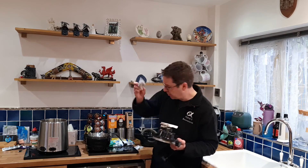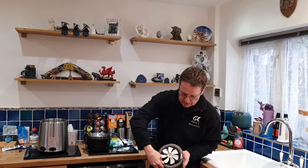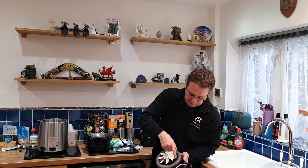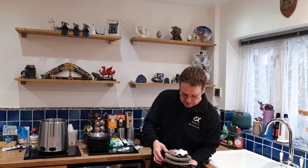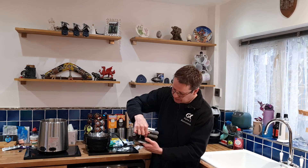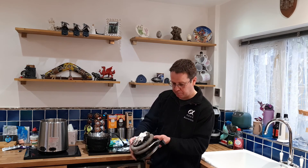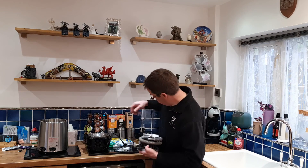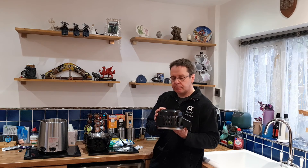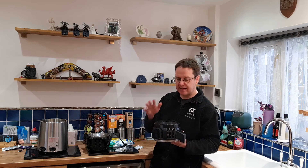And that's generally about it. To put it back in again, it's just lowering it down — it just fits over the actual fan blades. Locate the hole, and then gently — very gently — wiggle it back or forward, pushing down very, very gently. You need to make sure it is lined up in the hole. The actual plastic struts that come up — there will be three of them — will lock inside the blades. So it can be a little bit tricky finding the right location. What I would recommend: don't put it straight back together. Obviously, some parts are still going to be wet from your wipes, so leave it all exposed to naturally air dry for a couple of hours, then put it back together again.